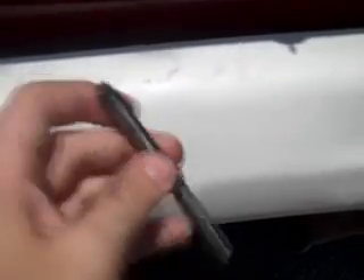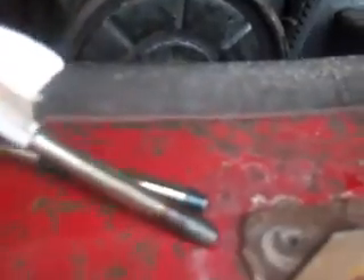I went and got the new push rod, and you can see there's supposed to be a tip on the end of it. Put it all back together and see how she runs. As per the idiot guide, I'm wearing my safety bandana to keep my hair out, because I need to get my head in and look in the hole to see where to place that pin. Once I got the flange in there, over at the top you can see there's a little bit of the rod sticking out. Just go ahead and stick the pump back on and rewrap the fuel lines back to the way they were supposed to be.